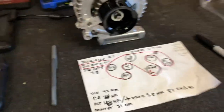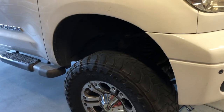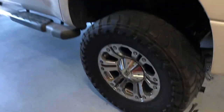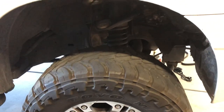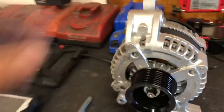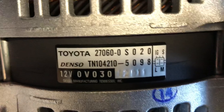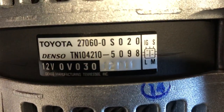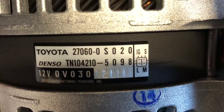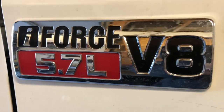That's about what it takes to get it out and back in. You don't have to take the radiator and shroud out like some people say. Run your tests afterwards — make sure you're charging correctly, rev it up, put some load on it. This alternator was from the dealer; I'll show you the part number in case you're wondering. Hopefully this helped you out — like and subscribe, don't drink and drive, wear a mask, and just don't be a loony. Take care, guys.